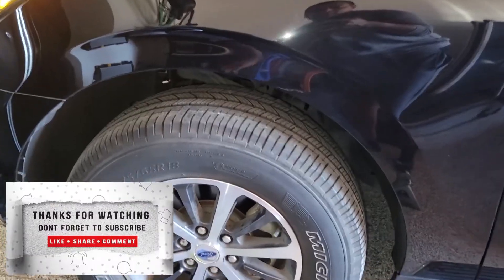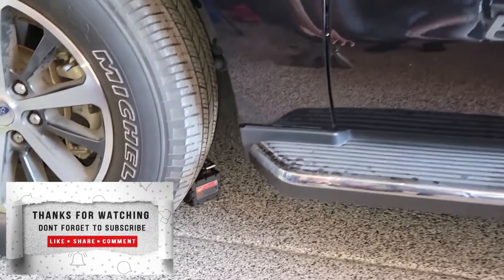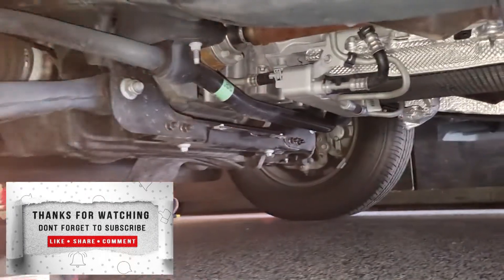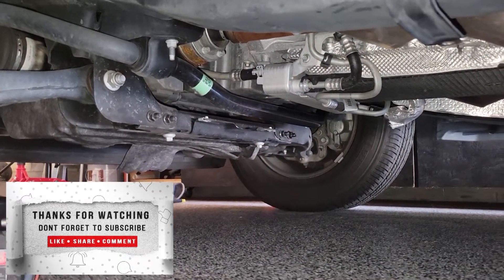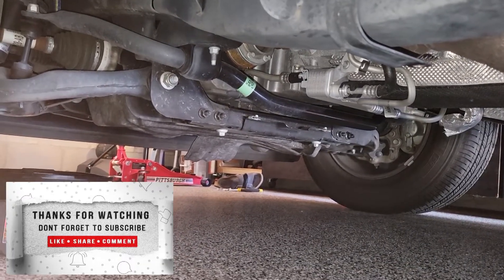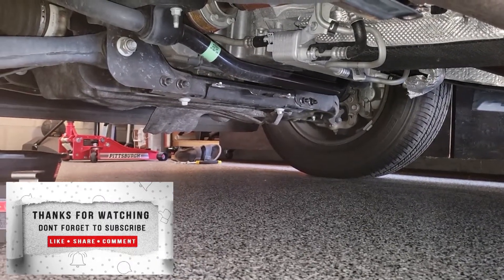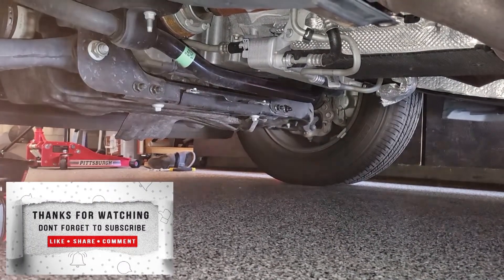With the oil level checking out, I'll reinstall the oil cap. I'll also go underneath the car and let the engine run for about two to five minutes to see if there are any leaks before I install the cover plate on the bottom of the vehicle. With that said, this install is over. I appreciate your view — hopefully it was very helpful. If you have any tips, tricks, or comments, please comment down below. If you appreciated my abbreviated style of tutorial, please like the video. That's a wrap folks — catch you on the next video!